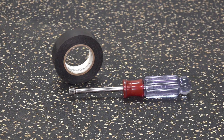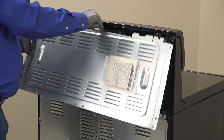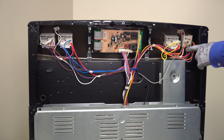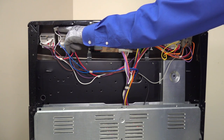To do this troubleshooting, you need a nut driver to remove the top back panel. You also need electrical tape to insulate the ends of the wires that you disconnect from the surface element switches during testing. First, pull out the range so you can get to the back of the switches. Unplug the range and remove the top back panel to reveal the switches and wires. This purple wire starts at the double element switch on this range and then connects to each of the other switches before it ends up at the element on light.